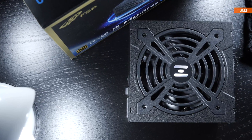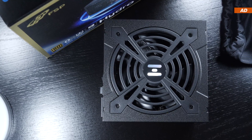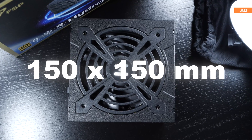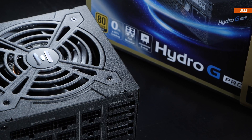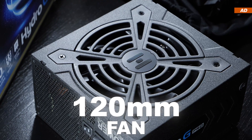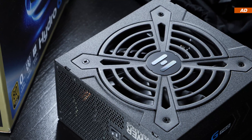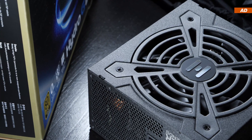I would like to note how compact today's Hydro-G Pro is, even in its 1000W version. We're talking dimensions of just 150x150mm, which is something you'd come to expect from 550 to 850W units. Of course, this also means they've gone with a 120mm fan only, and not 135mm, as is often the case within this wattage tier.